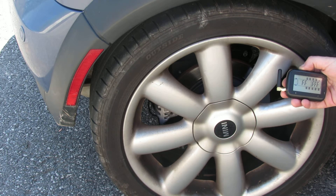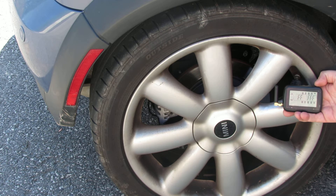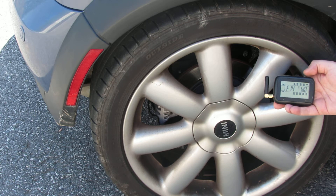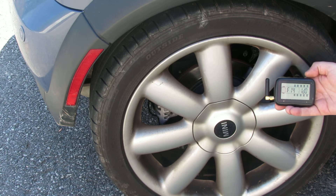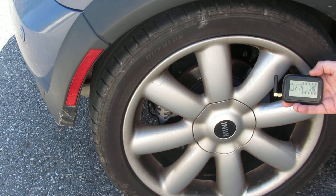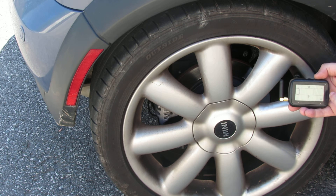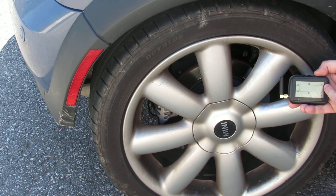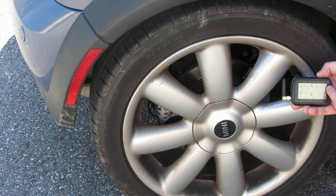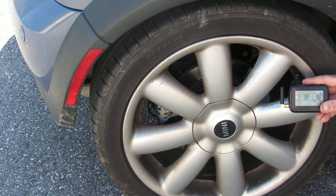In this case it's going to be the back right tire, which you see is blinking. You hold the monitor right up to the sensor and tap the code button. As you see, the code went from all Fs to a six digit alphanumeric code on the monitor. When you have programmed all four of your tow car tire sensors into the monitor, simply tap the mode button. You will see in this illustration we have the back right tire programmed. Now the monitor will start reporting pressure as well as temperature, as you can see here.